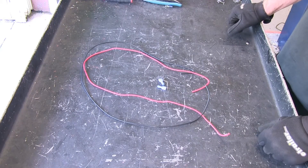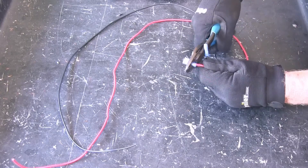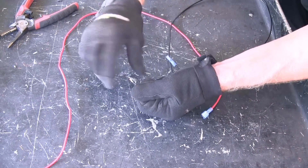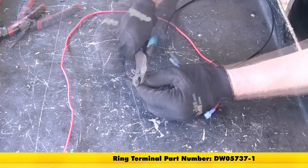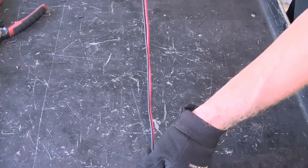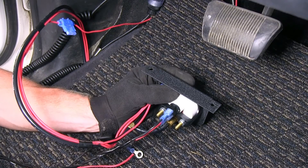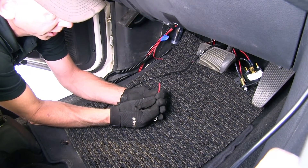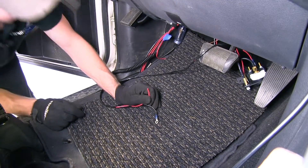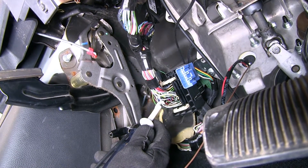Next we'll do some sub-assembly for wires that handle illumination for the dial. We'll strip these two wires back and add the two terminals that'll fit onto the back side of the light. Still working with black wire, I'm going to use this for my ground wire, so to this end I'm going to add a ring terminal — a ring terminal doesn't come with the kit. We'll use some electrical tape to help bind these wires together. Let's go ahead and attach our wires to the terminals for the incandescent bulb — it doesn't matter which one goes to ground or power. The red wire is going to connect to a wire underneath the dashboard that gets hot when we turn on the headlights. We located a wire just behind the parking brake pedal — it's white with a light green stripe. Using a light tester, we grounded it to the interior sheet metal and testing the white wire with the light green stripe, we turn on the running light circuit and we have power.